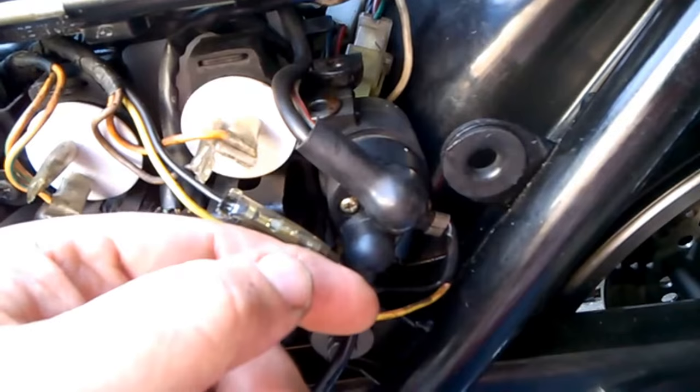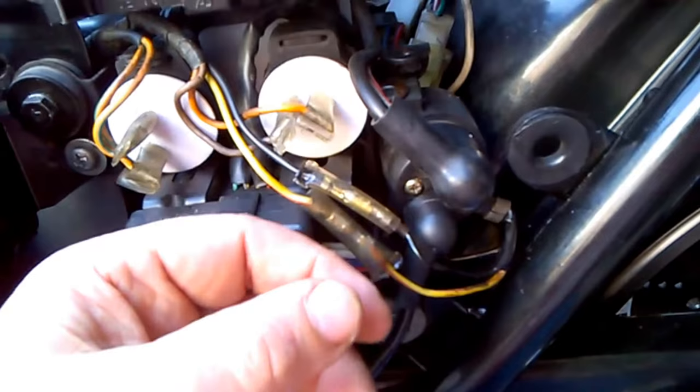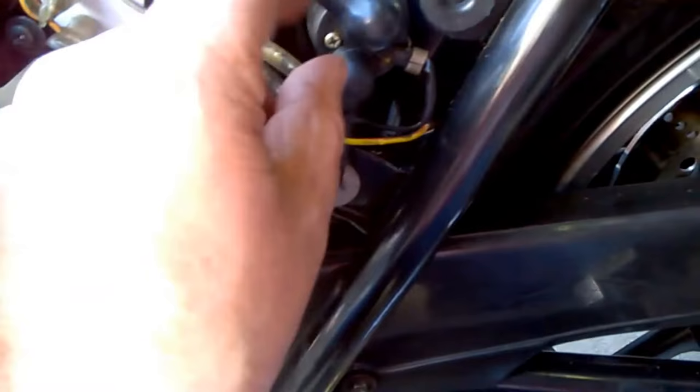So the solenoid is often a culprit. You can test it easily by just taking it out and connecting these wires to a battery terminal. The solenoid will make a very definite click and also physically jump - sometimes jump on the table. That's a quick way to check it. You can get your continuity tester out and test it more thoroughly if you want, but that's a simple way to do it.